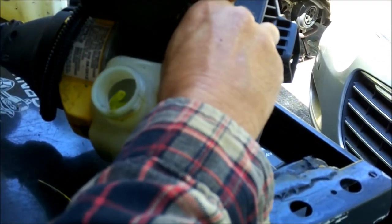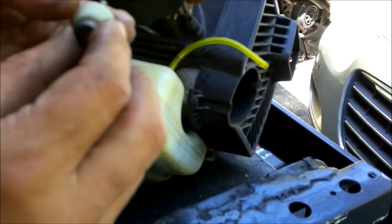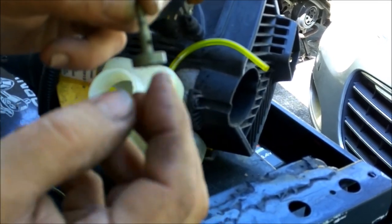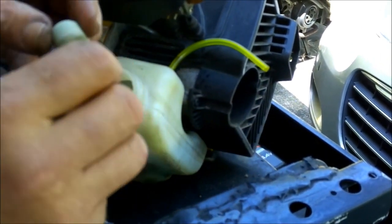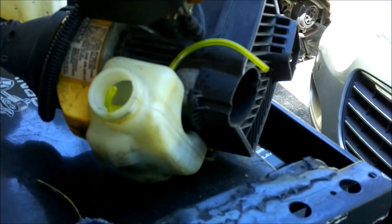It's nice and free. You don't want to go too long, so we'll kind of gauge it with that. It kind of went up through there, kind of went down, because you want it directly on the bottom. I might have went a little too far — just pull it back out. This is the filter I was telling you about. This is actually a weight — same thing with a chainsaw. It's a little heavy to help hold that down to the bottom, and this is your filter. I've cleaned it out and blown it out with compressed air.